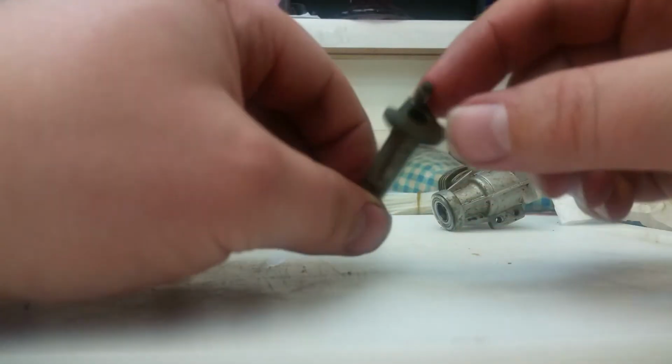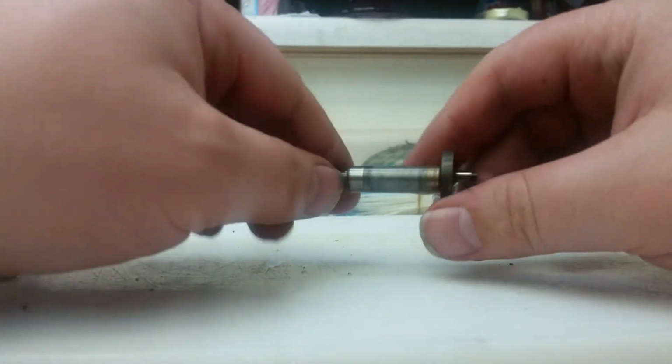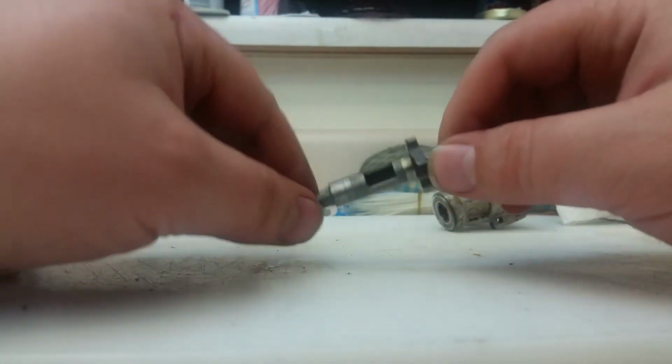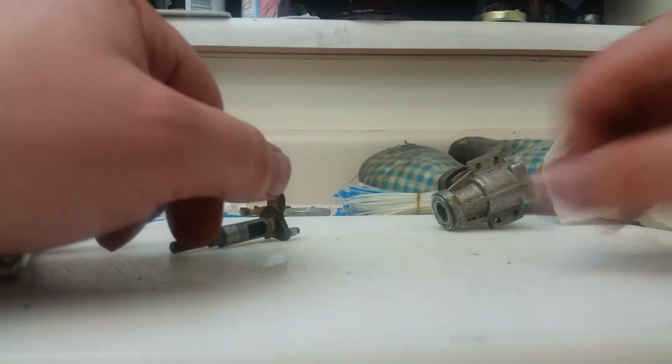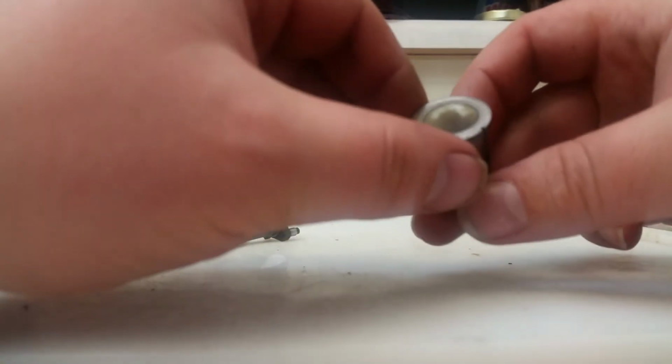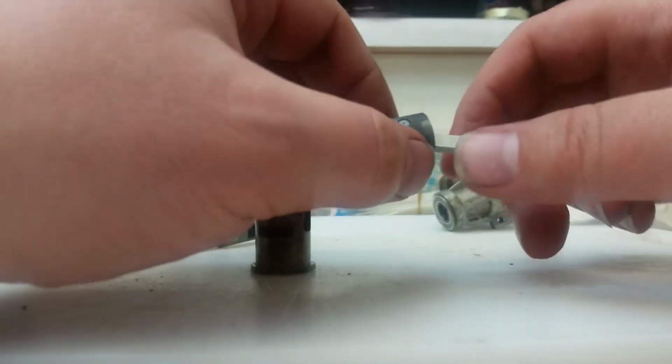Can't feel anything with my thumb. It's a little dirty, but hey, that's not bad. That's totally salvageable still. If I send that piston and rod assembly away and have it cleaned up a little bit, I think we might just be able to revive this old 12, maybe with a fresh set of bearings, maybe a new rod. This rod's looking awful thin in the bottom.